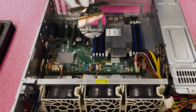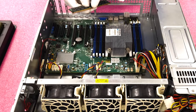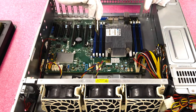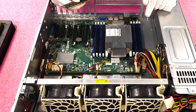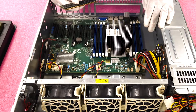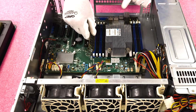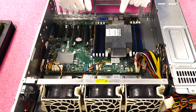This key is very important because it is not perfectly in the center — it's off slightly, which means you have to line this key up properly in the socket. If you put it in the wrong way, you could potentially damage the leads or the DIMM slot, which could throw the whole channel off and mean you'd have to replace the motherboard. So just make sure you're lining it up properly. In this case we're going to put it into A1 — slide it in, make sure everything's lined up, and that's the proper way to do it.